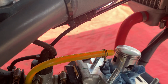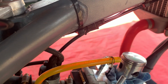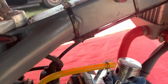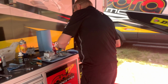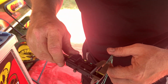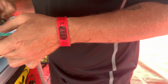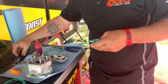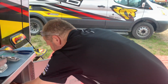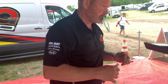He'll be able to grab the cylinder here. He's gonna check his base gaskets. Which one you gonna start with? I'll start with a 4 because that's the way it was stamped in the beginning. You notice he measured that base gasket in more than one spot, and he'll make a mental note because this is fine tuning that matters on this. That base gasket, I know I saw it a couple times.